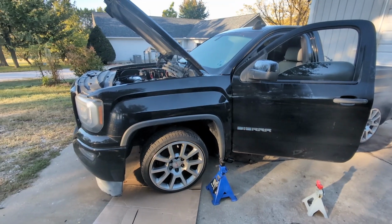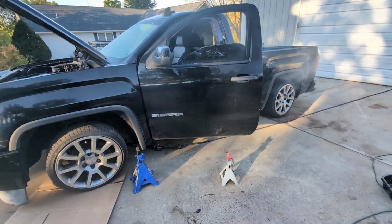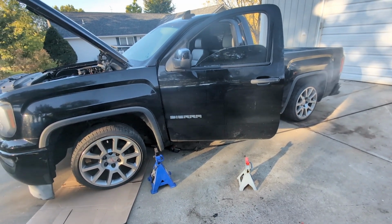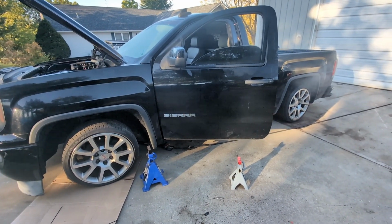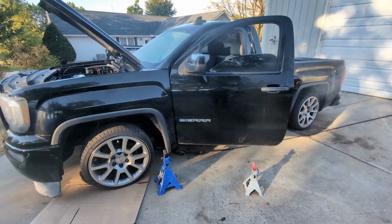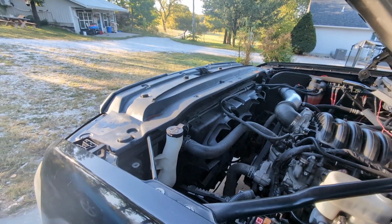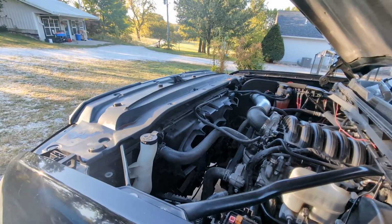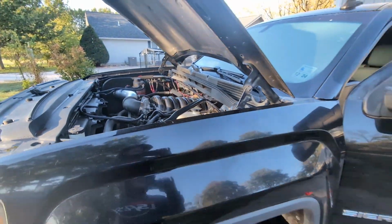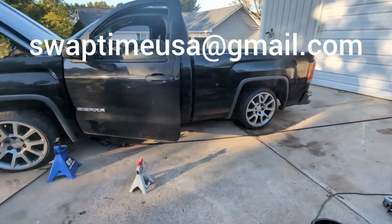And then we'll go over some other things like the drive shaft. The customer is actually able to buy a brand new drive shaft, made by GM or whatever. He said it's like $200, and then he reused the factory crossmember by doing a slight modification to it. So that's good news. And then it's best to put the V8 radiator in it because the ports are in different locations to match the V8 engine. So it doesn't seem too bad. You just gotta know what to do.